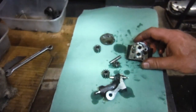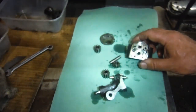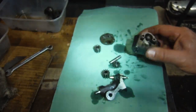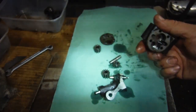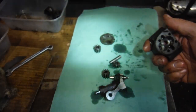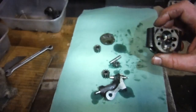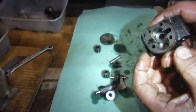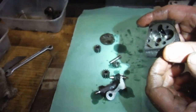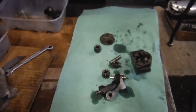It'd be a shame to put this back in and still probably have to rely on the oil tap. If it was my engine I'd want a new oil pump in there, and I'd probably do away with the oil tap as well, because I'm pretty sure a new oil pump would render that tap redundant — not that I'd ever have a tap fitted in any case. So a new oil pump I think would be a good idea; I'll speak to the owner and see if he agrees, and that's where we are with it at the moment.